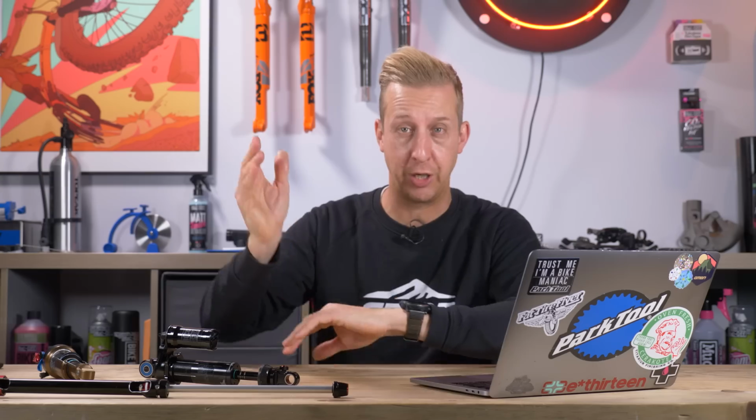But as technology changed, I think the first, I'm going to say, DHX Air. It was a downhill shock anyway by Fox, and they did a coil version and an air version. I think that was the first one that opened my eyes to what air shock capabilities could do. Now, it was flawed. It had inconsistencies with rebound damping, which I remember specifically riding a Marin, one of the Quake XLT style bikes, and the damping had gone completely, and I hit a jump and nearly went out the front door, and it was scarier than not crashing because you so nearly crashed, if that makes sense. But it was a real good look to the future.